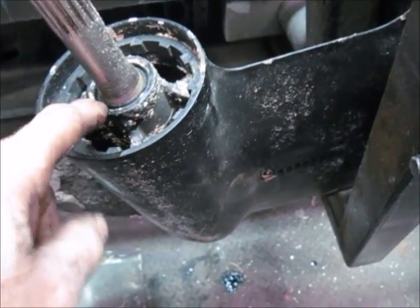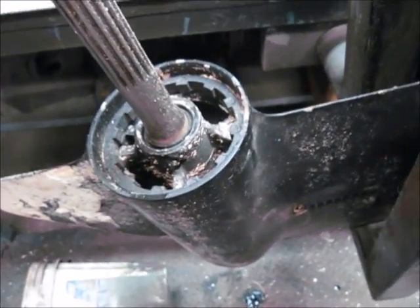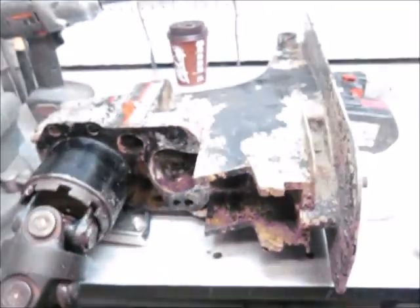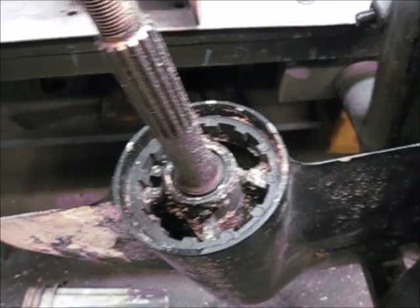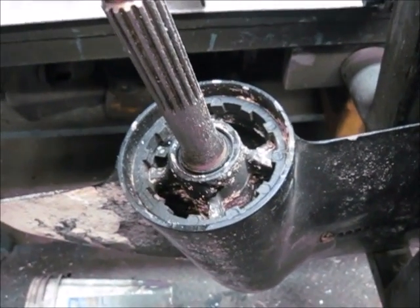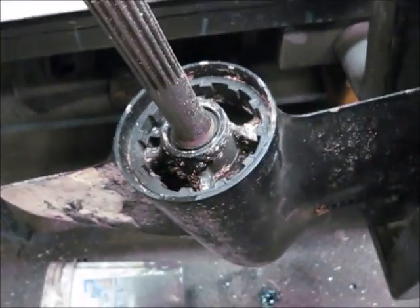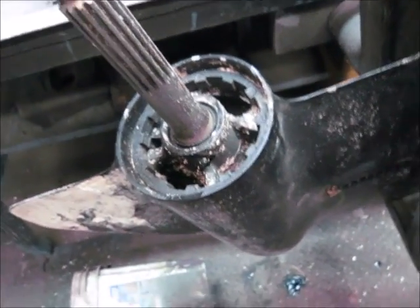With fishing line in there, usually what happens is it goes dry at the top before you can notice it, and then the upper gear set locks up, the bearing seizes, or the gears go at the top. So it's important you check your oil regularly.